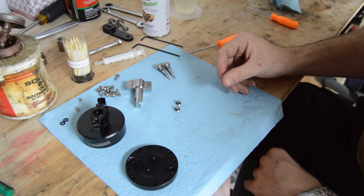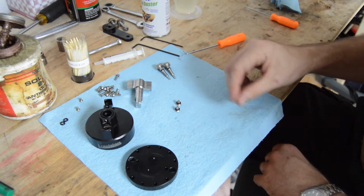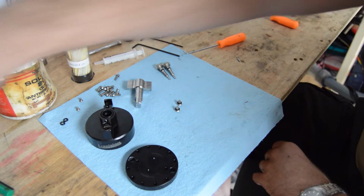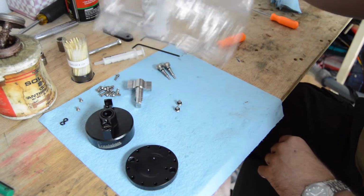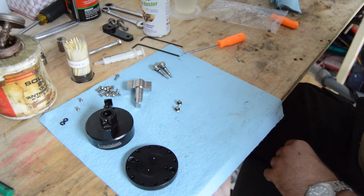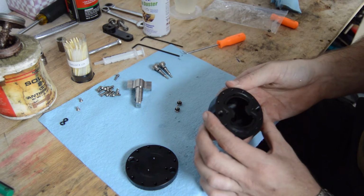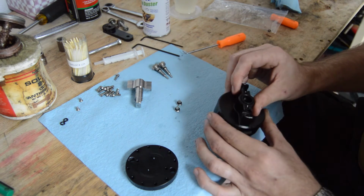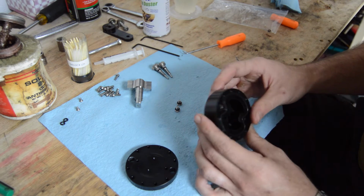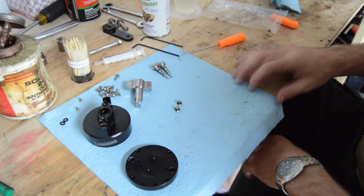and a relatively large diameter overall shape. With your completely disassembled steering damper, you can now take all your individual O-rings out, and keeping them all nice and organized, put them in a little Ziploc baggie, run down to the auto parts store and get you some new rubber to come back home and reassemble this guy. So I'm going to begin the reassembly, and after I've got it all reassembled, we will walk through how to properly fill this thing up and ensure that there is no air whatsoever inside of the damper so that it works exactly how it should.